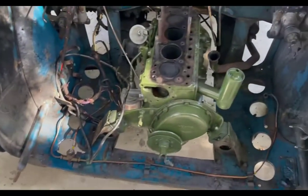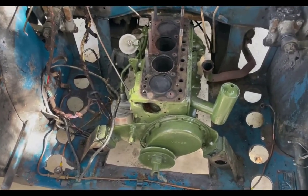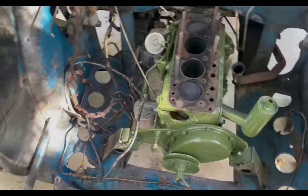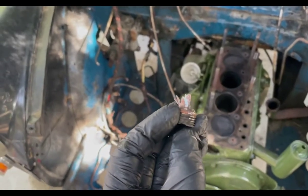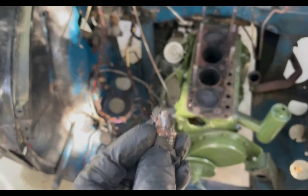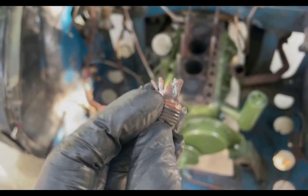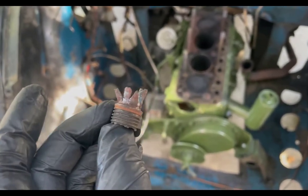I'm going to be refinishing this and seeing if the grill is salvageable — that bit of chrome isn't great — but for stripping down the rest of the engine compartment, this is fantastic access. I started today to take the head off to fix one little thing: to remove that bypass adapter tube. It took a day to get the head off and get it out — we went to my son's shop to do that. Then I decided to go after the engine compartment, start getting it ready for stripping and painting, and decided to pull the front cowling and grill off. Not bad for a day's work, and thankfully that bypass tube is out now.